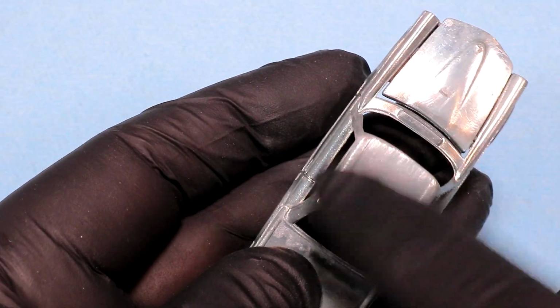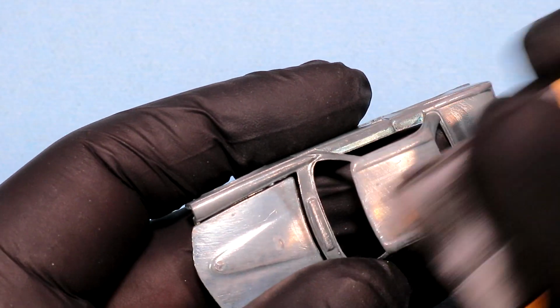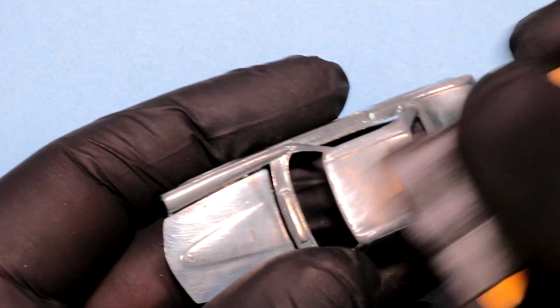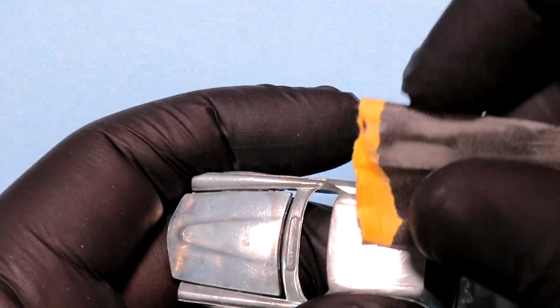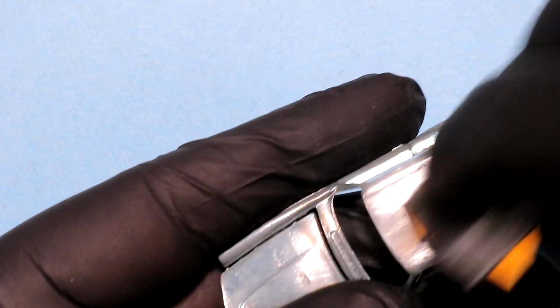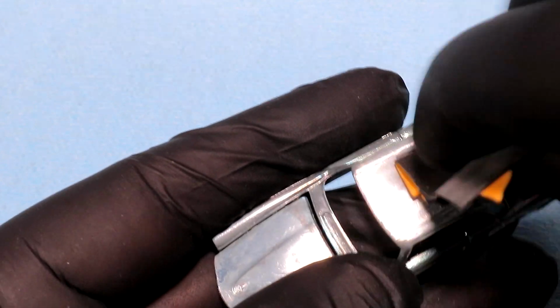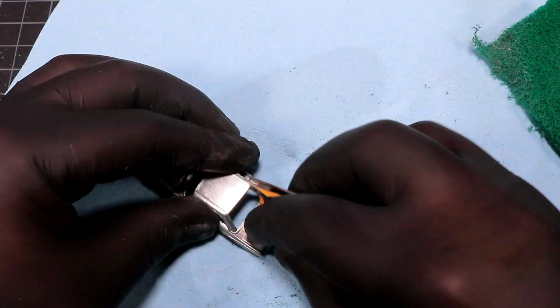Nice and bright there. So that's our zinc. Looks good. Just those couple dark spots, which if we sand through, I imagine we'll have a hole in the zinc. No sense zincing over top of oxidation. I don't know if you even could, but it's just gonna keep rotting if you don't sand that out. So that's what we gotta do, man.